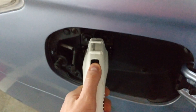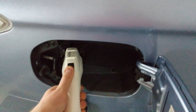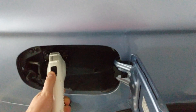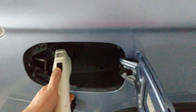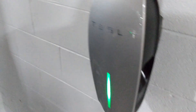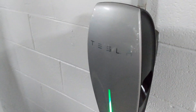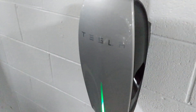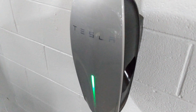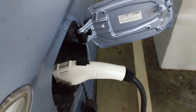By pressing this button for 10 seconds, what that does is it causes the Tesla charger to fall back to the J1772 protocol, and then it will go ahead and work with your car. Just to add one thing — this is working with a three-phase 22 kilowatt charger. There were some reports that it may only work single phase, but this is three phase and working fine.